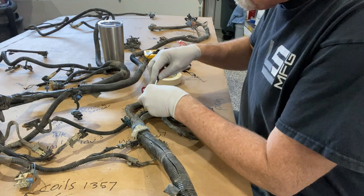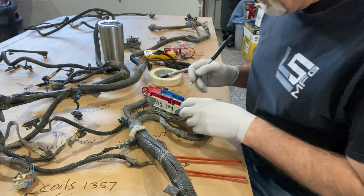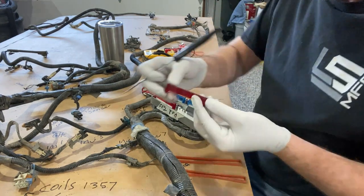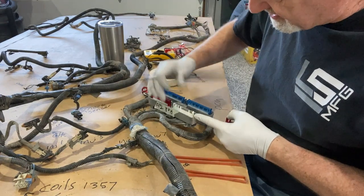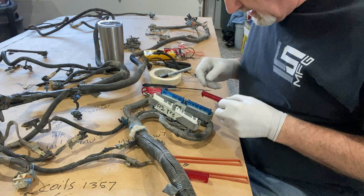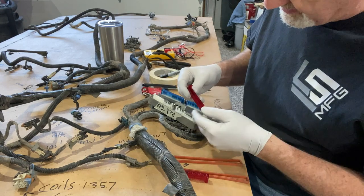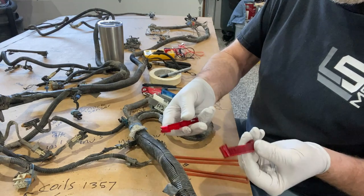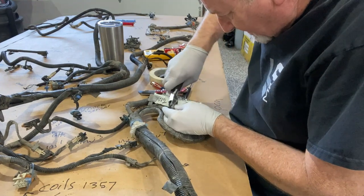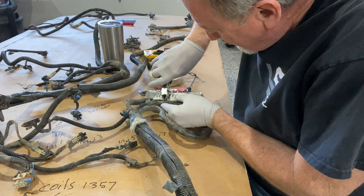Getting started. An ice pick is a good tool as well. You just have to gently remove the colored connectors — on the inside there's a little tab on either side, just press in lightly and lift, it comes right out. They can only go on one way; there are little tabs or notches that correspond with slots, so these little colored connectors can only go in one way. Be careful and take your time as you're taking this apart so that you don't clip a wire accidentally.